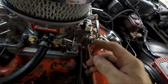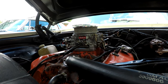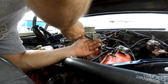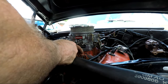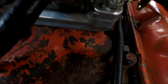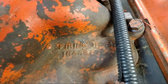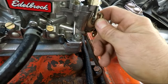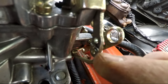One other thing I want to do before it gets hot - I want to change this accelerator pump position to the middle. Working with a really small part here. I'm gonna lose this little pin - it's super small and I don't have another one. Oh shit - there it is, phew. Let me show you the size of this little clip I'm working with - that little clip is what holds that accelerator pump on. Just want to move this to position 2. Now that's the way it goes. All right, back on middle position.